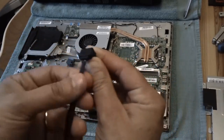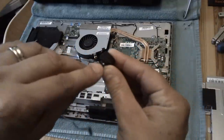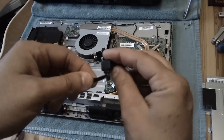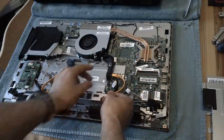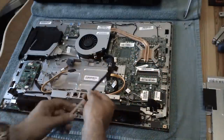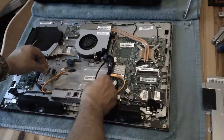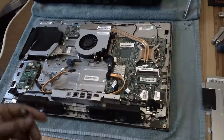There was a bit of fatigue at this end of the cable and it's broken something inside. In fact you can see that the internal cable is visible - I haven't done that. It wants to fold like that because when they put it in, they bent it, fed it along the edge, fed it through there, and screwed it in. So the first thing to do is remove the cable.